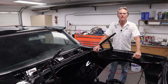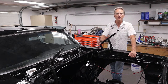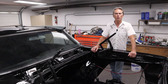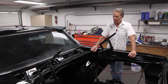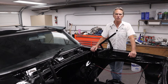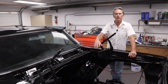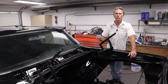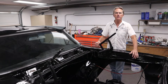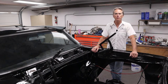Hi, I'm Mark. Welcome back to Foothill Paint Fabrication. We're back on the 65 Chevelle Malibu SS, and since we got everything painted, we can move forward and start putting some chrome goodies back on. This car was originally four-wheel drum brake with a single master cylinder, and we're converting it over to four-wheel disc with a dual master cylinder and a brake booster. So we're going to be working on that today, getting brake lines back up front, getting the inner fender well back in, some wiring cleaned up, and buttoning up this side of the car.